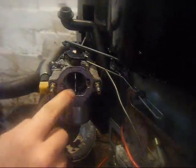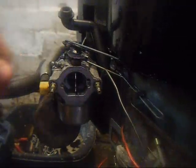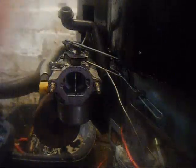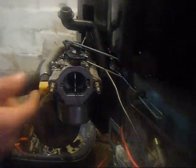You've got your choke here and your throttle. Every now and again it's a good idea to adjust your idle screw — otherwise when you put it down to idle it can stall, or sometimes it won't have a very low idle. Make sure your fuel is turned off.